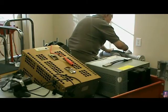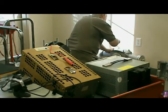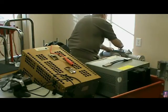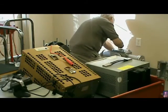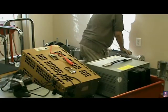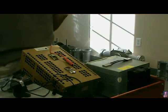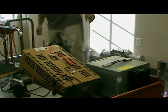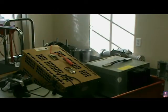Anyway, it's either that, or you have to put a slightly heavier angle on them and make them a little closer together. These are absolutely perfect, but those are giving us a jump back. I've got a feeling it has to do with the spark plugs as much as anything. Get the oil off. Yeah, that's what I thought. And the other thing I'm looking at when I look at these plugs, look at those plugs, that one's got a great big metal thing going down through there. And this one looks like it's got a little bit of pin on it.